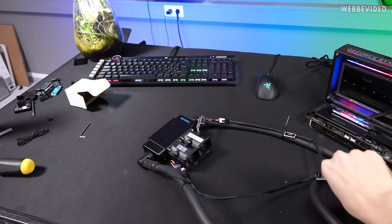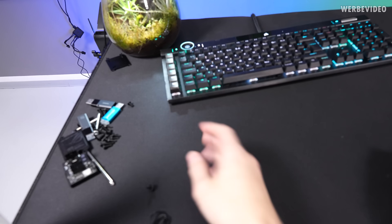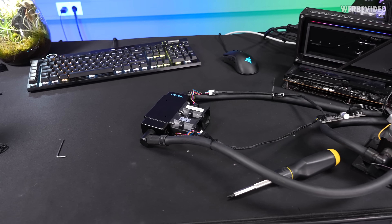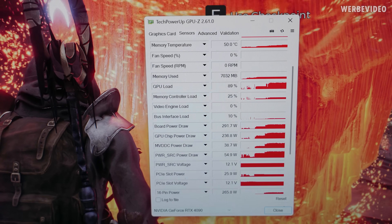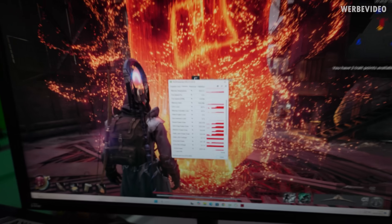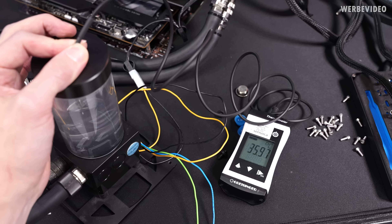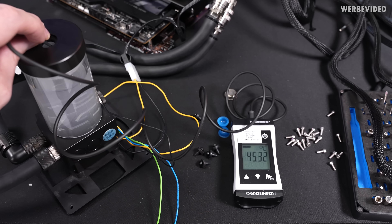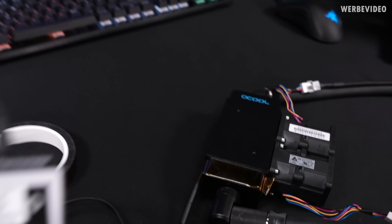It's always a bit difficult to visualize the fan speed, but you can see the fan box vibrating. We'll start a little bit slower and gentle to see if this is instantly failing or not. The fans are spinning at a lower RPM so I don't have to suffer as much. This is Remnant 2 with a more relaxed gaming scene. You can see the board power draw is currently about 300 watts. After only two minutes, we already have a water temperature of about 38 degrees Celsius and it's still increasing. Another five minutes later, we're already at 45 degrees Celsius water temperature. I also taped a temperature sensor to the back of the radiator to check the air temperature.